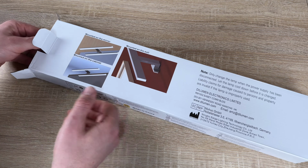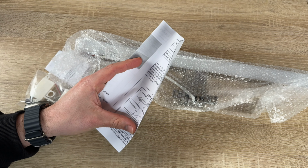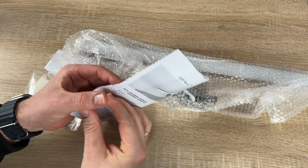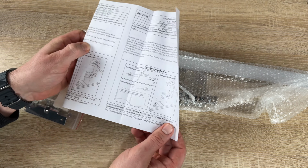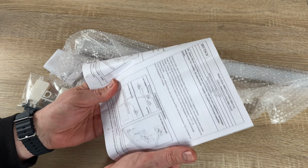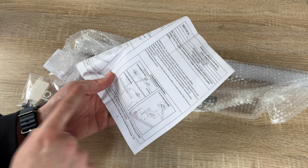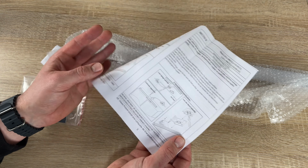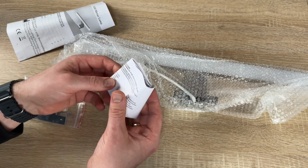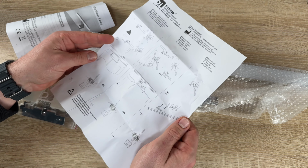That means we have two wires there. These two wires are blue and brown. Brown is the live line, the L line, and the blue one is the return line. This is the neutral N. We connect the unit to the power mains. We make sure that the power line supplies the correct voltage required by the unit. This is 230 volt. To clean the unit, we turn off the power first.